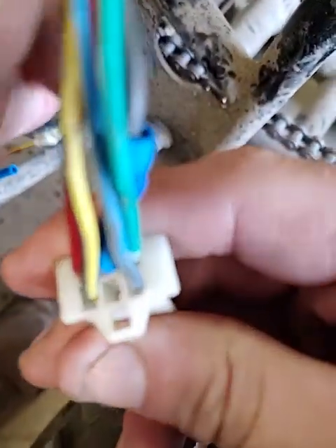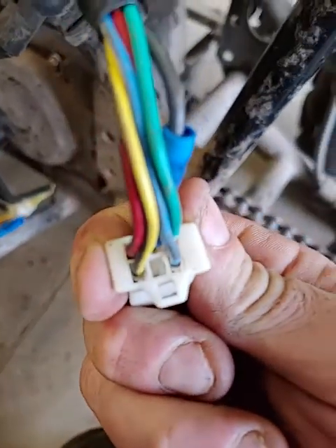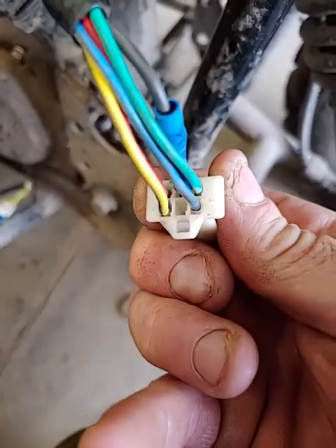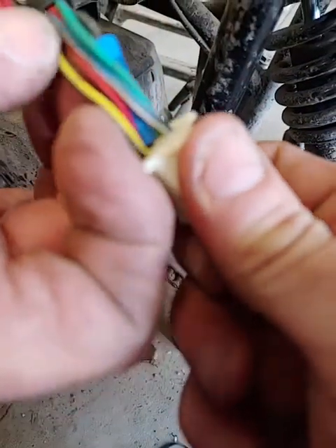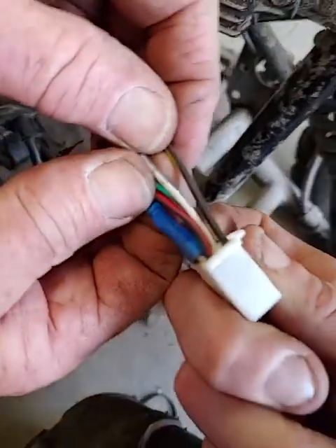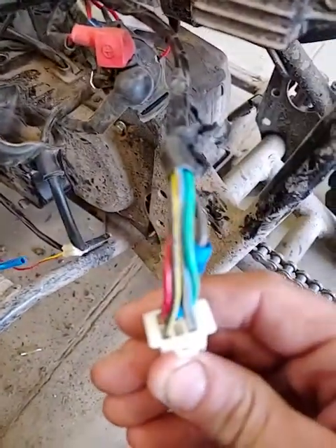But that's no kill switch — he added his own kill switch. So what you're gonna have here: a gray wire, and the black and white is gonna be your kill switch wire, coming out of the center of the blue connector — that's the black and white striped wire, and that's gonna be your kill wire run to your kill switch. Green wire is ground. Yellow and black stripe goes directly to your coil. Blue and white striped goes to your stator. Red and black wire also goes to the stator — red and black wire straight to the stator. We use the same plug-in connection; you don't even have to mess with those because they're already there for you.